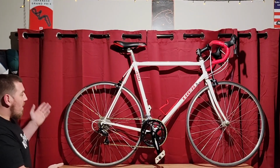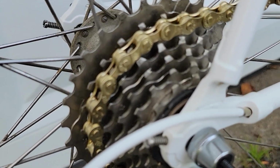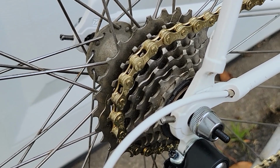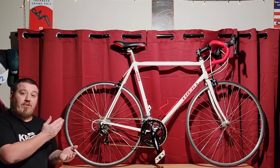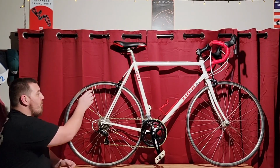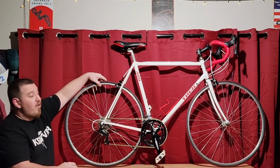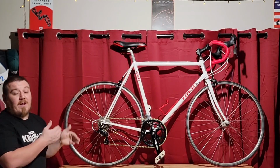Now, secondly, we kept a freewheel style wheel set on here because it's what came with it, as I just mentioned, the wheel and the tires and all of this. It's easy to keep it for a 7-speed like this, and honestly, it could never give you an issue as long as you keep good maintenance of it. These are nice and true, no issues with any of the nipples, no cracks. These honestly have next to no wear on the rims,